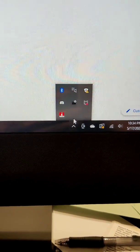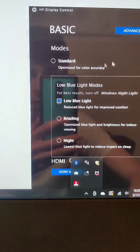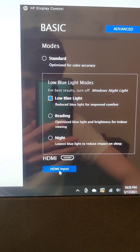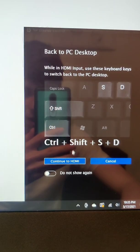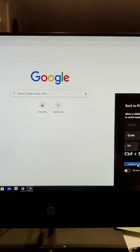If you do support it, down here you'll see this icon — 'show hidden icons' — that's what you're going to click. Then it's going to be HP Display Control; click that. It gives you these basic options, and you just go to HDMI Input and click that.